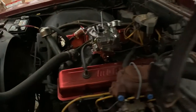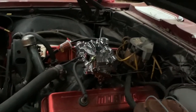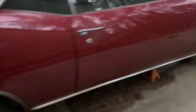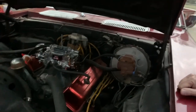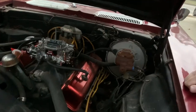There was some black fuel coming up through the filter originally — the fuel that came up through the filter was black. Then she fired up — and it works! Yeah! Sounds like it's misfiring a little bit though — we need to change the plugs and wires out. Look at all that smoke. Go stand behind it — unless that's just how your headers sound.